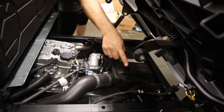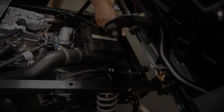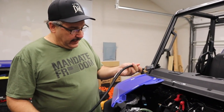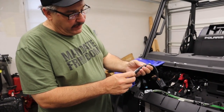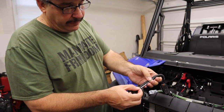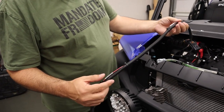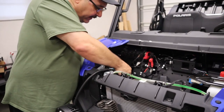We're going to come up and plug in right there — that's for the rear lights. This is the back of the harness that we're going to feed all the way to the back tail lights. It's a really nice kit because it comes with a wire if you want to hook up a license plate light, and if you want a third brake light you wire it to this light right here.